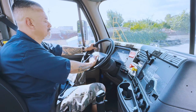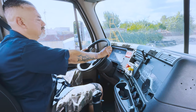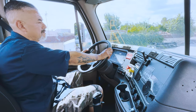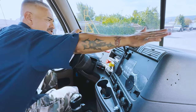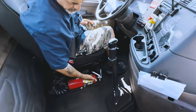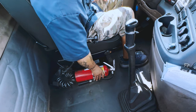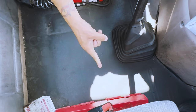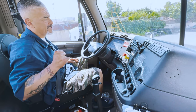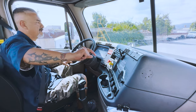This is my city horn. Highway horn, working properly. My right signal turns on and off. Left signal turns on and off. My AC, all speeds, hot and cold in the defroster — cold and defroster all come on and off. This is my fire extinguisher. It should be updated, at a full max level, not missing, clamp not cracked, mounted and secured. I have three emergency triangles — they should not be cracked or missing, no discoloration, and they're amber in color. I have four emergency flares and a first aid kit. My left mirror and right mirror — bolted tight and secured to the truck, not cracked, adjusted so I can see my left and right side of my trailer.